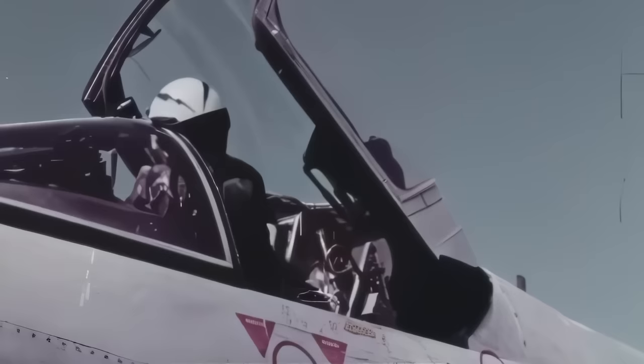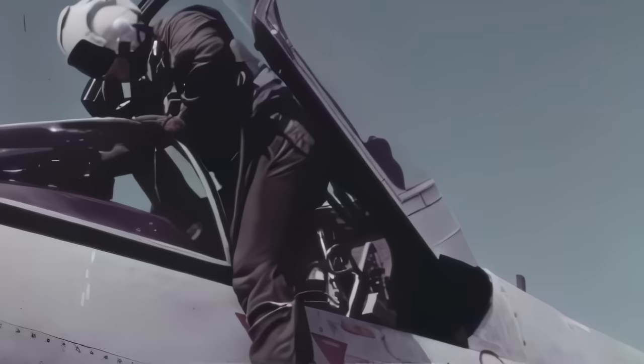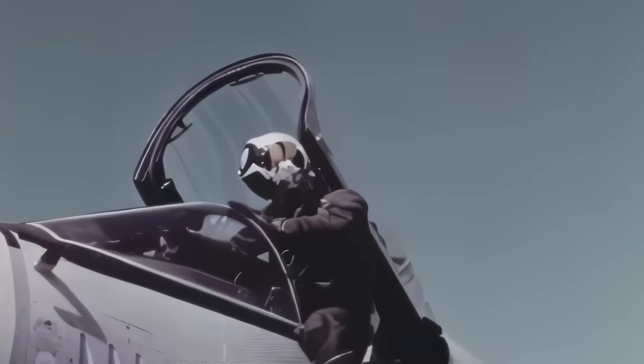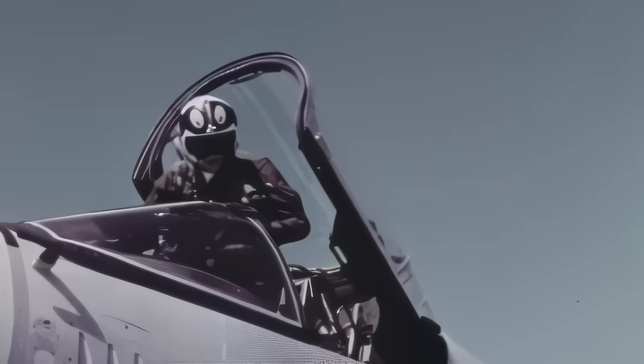On the way out, make sure you don't hit the throttle or pop the bailout bottle with your feet or flight gear. The same caution applies to the switch pilot as he mounts and moves into the cockpit. Hold the brakes and strap in.